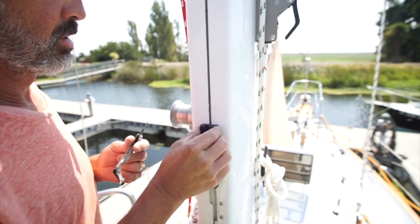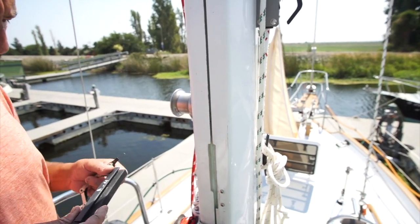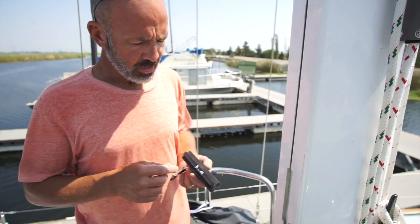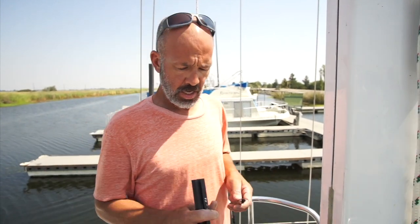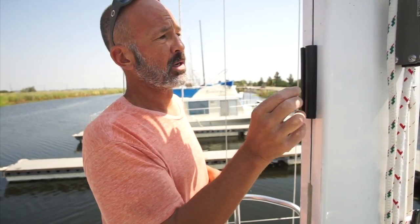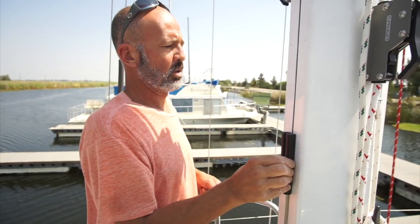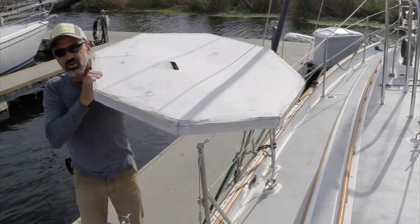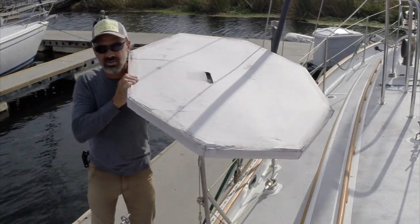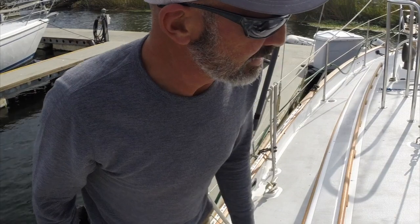The sample piece from Tides Marine was an A4 profile, and they come lettered and numbered so each one corresponds to a little segment on the disc. Adding 1.12 millimeters to both dimensions, the track should fit a little bit better, because when the sail's under load you don't want it doing that back and forth or in and out — it'll eventually wear out.